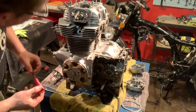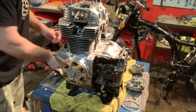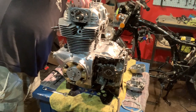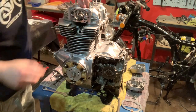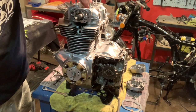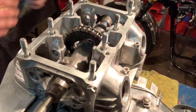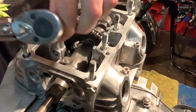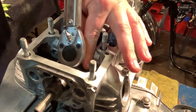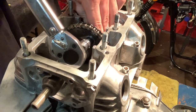So here we go. I'll go ahead and Loctite. Red Loctite, the good stuff. And then we will get this one started, and then I'll go back and torque all of this up as best as I can, honestly. I'm hoping this torque wrench is going to work in this configuration. And just notice, guys, I'm really trying to follow the manual as best as I can, so I actually did not torque this until I had this other bolt in place.